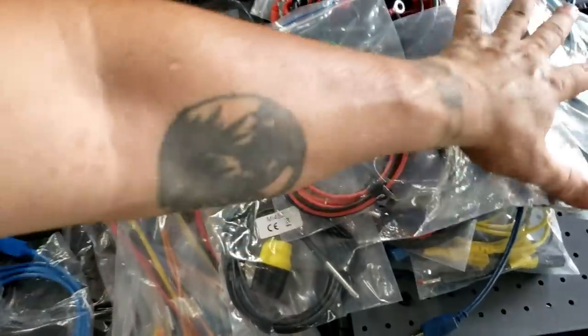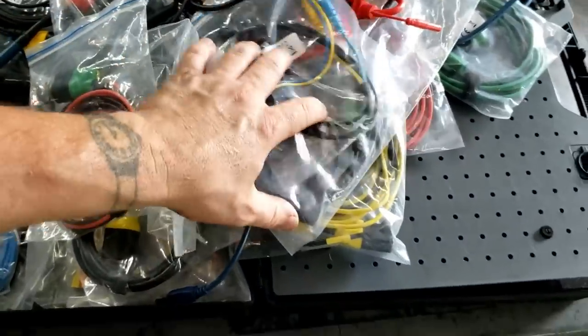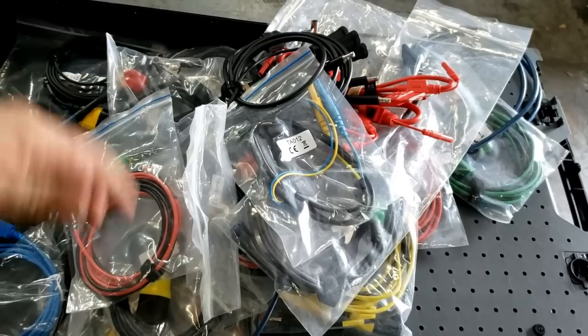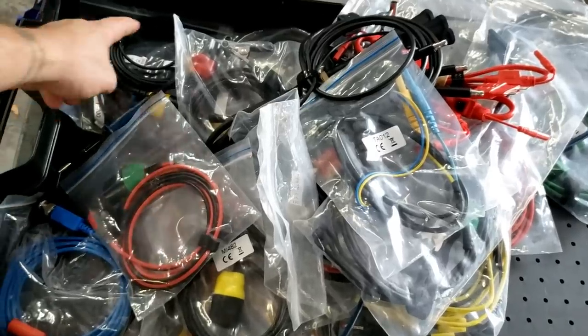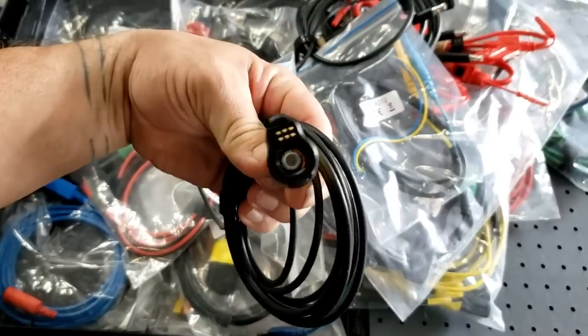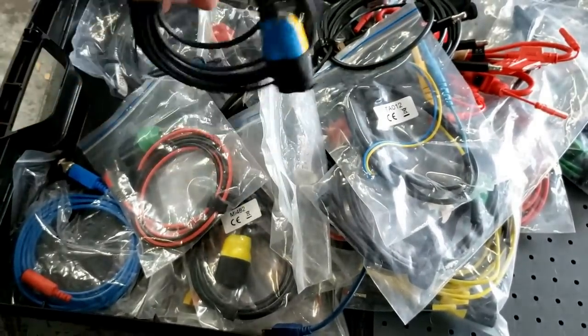That's one thing I forgot to mention, if I can put this stuff back, is you can still use regular BNC leads. So if you already have BNC stuff or your old Pico, it'll still work. You just have to go in and tell the channel what probe you're using. No big deal. It's just cool to buy the kit and have these BNC Pluses, where a large percentage of the stuff you're plugging in, it automatically detects.